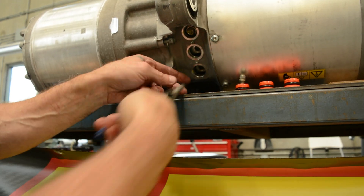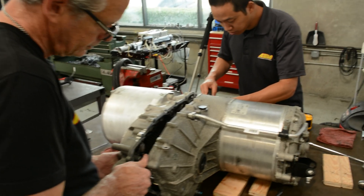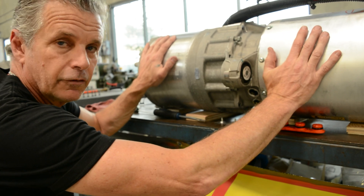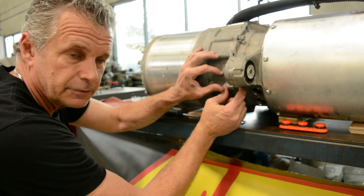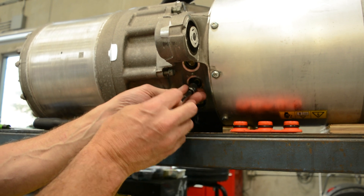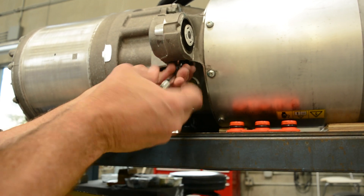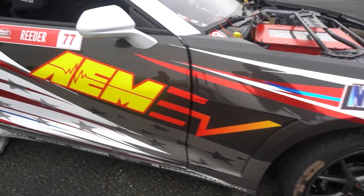I leave these bolts in when splitting the case initially, and then as we bring it apart further, I like to have two people — one managing the front where the actual differential is, and the other at this end with the inverter motor — making sure the separation doesn't exceed about an inch and a half to two inches max. Then you can clamshell it to get your whole differential out. These have a dielectric compound, almost like a paste, to ensure continuity and prevent corrosion, so sometimes they don't want to come out easily.